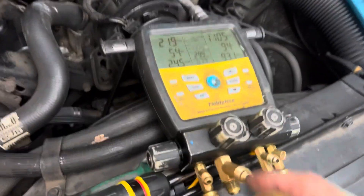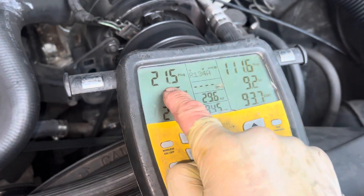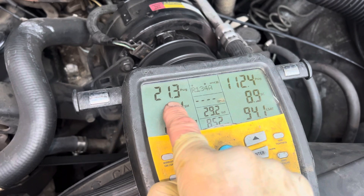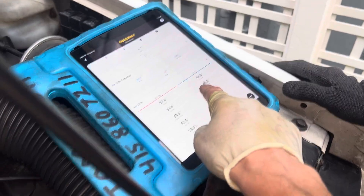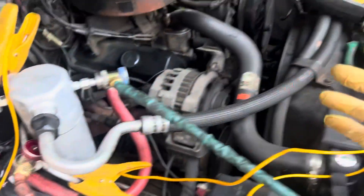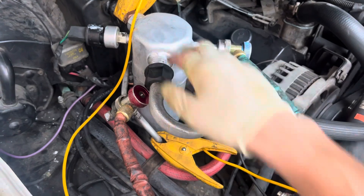Back on the 1986 Chevy S10 — I almost got it to 21, I had to adjust the switch down to close to 21 PSI. It's running at 21.3 and it cuts out, and it gets down to 44 degrees Fahrenheit on the dash. This was the one where they forgot to put the orifice tube in, and it was only going down to 49 PSI or so. I had the dirty orifice tube.